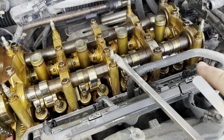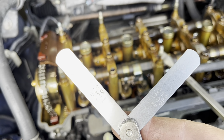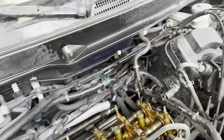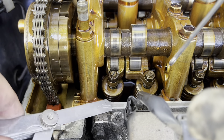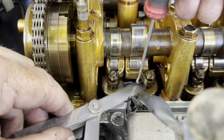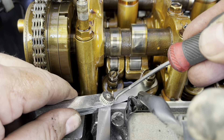I'm going to start by doing the intake valves first — that's the front side. I'm using two gauges: 0.305-millimeter and 0.229-millimeter. I get these numbers from what Honda printed under the hood of my car. I follow a method similar to Eric the Car Guy's: on the intake, I like to have the cam lobe pointed up, then pull up on the rocker and slide my feeler gauge in. You should just feel a slight drag.